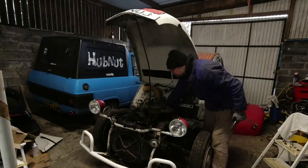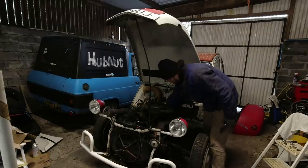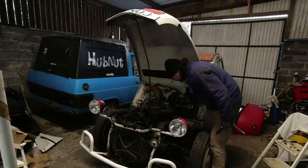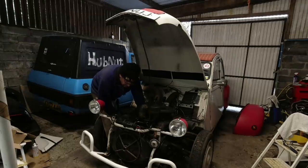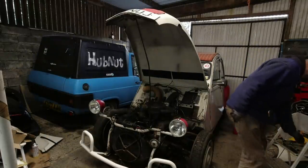I have disconnected the battery because we're going to be disconnecting the alternator, and if the alternator wires start touching again, life gets rather exciting. There aren't many fuses on a 2CV - four in this case, although I've added a couple more. I've got extra ones on the headlamps - the headlamps are unfused from the factory. That one's definitely a 16. Notice this one's a 17. I don't know why Citroen mix things up like this. Older 2CVs tend to have 12mm headed bolts, even though it's a 7mm thread, which would normally be 11mm. Manufacturer specific bolts - we get quite a lot of them these days.